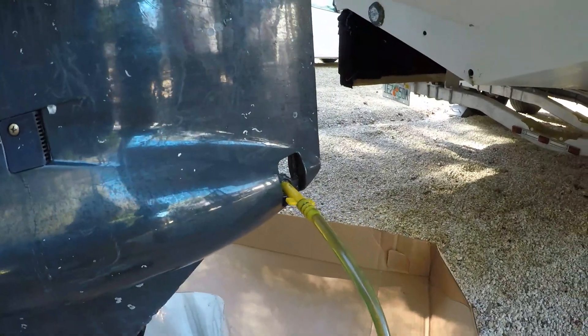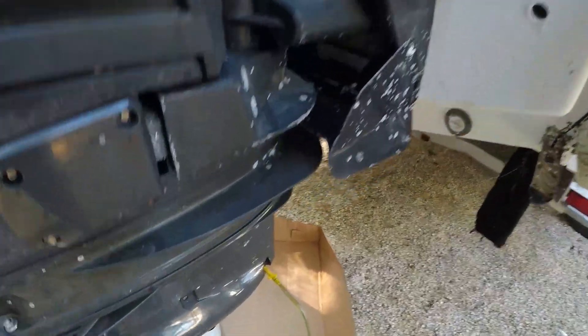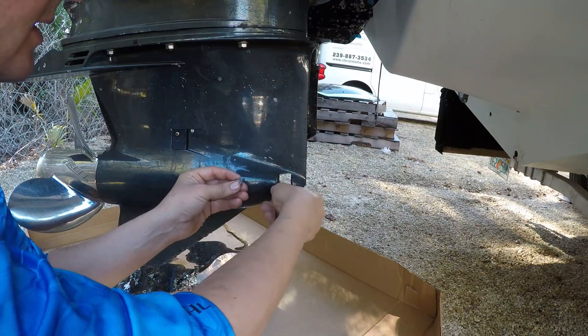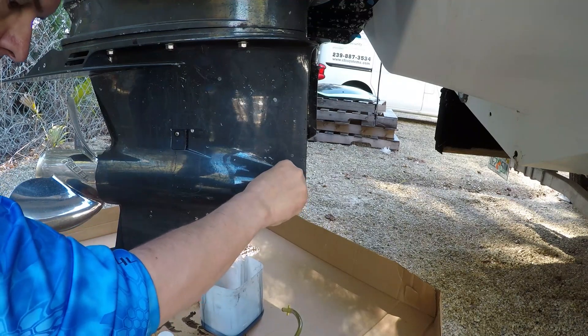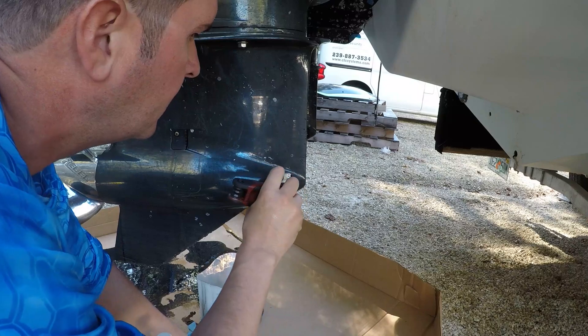The pump bottle is holding the oil in there for now, and I'm going to have my drain screw ready to go. I'm going to put the tube back on the ketchup bottle — what that'll do is create a suction to make it a little harder for the oil to come rushing out. You'll lose a little bit but you saw how fast it came out before, so it's not going to come rushing out. This thing will kind of just free spin in the tube — have your allen wrench ready and just be ready to stick this in there real quick and thread it in finger tight to stop the oil from coming out. This thing is designed to smash down — don't strip out the threads, but you do want to tighten it until you feel that little nylon washer kind of smoosh out a little bit.